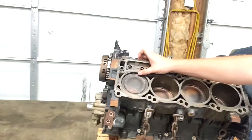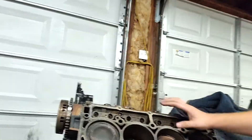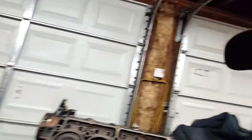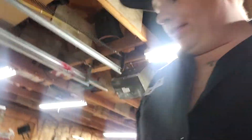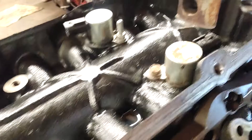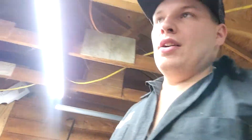All right, I've got the heads off. One thing I notice right off the gate is they've got little tiny valve reliefs in these pistons. I haven't done the research but I'm guessing the compression — and obviously the stroke — is probably different than a 5.7. Otherwise it looks really good. There is only on one cylinder wall a little bit of scuffing at the very tippy top, and I don't think it's anything bad — it'll clean up with the hone. On the other side, everything looks really good too. Nothing dramatic, no big scarring, which is to be expected out of 66,000 miles.